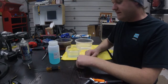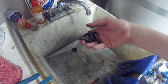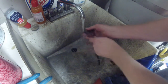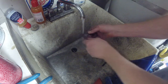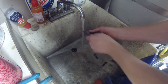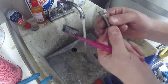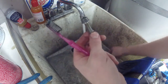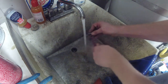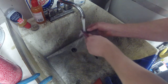Let's get to it - I'll show you the steps I've been going through to apply this and the results I'm getting. The bolts I'm using in this are front brake caliper bolts. These have been in a carb cleaner dip for about 24 hours. After the carb cleaner dip they come very clean, and I give them a quick scrub down with a toothbrush in the sink, getting rid of stuff still on there - the extra carb cleaner, grit, getting it out of the threads and everything. I find the bolt ends up very close to the original look, very clean. These bolts came out looking very gunky, but scrubbing them with a toothbrush after a 24-hour carb cleaner dip really seemed to do the trick.